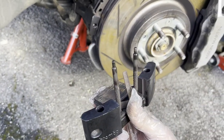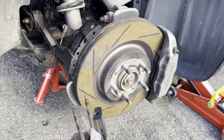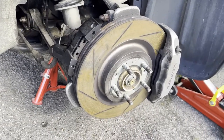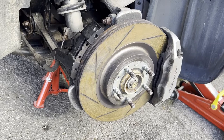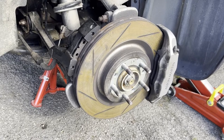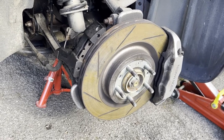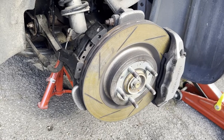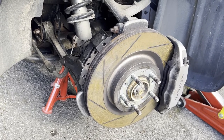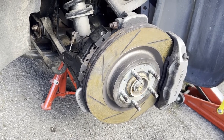Okay, so that seems to be a much quicker way. Now if you're replacing the discs, like I'm planning to, you can just pop the disc off without actually having to remove the whole brake caliper. I'm going to fast forward a bit to popping the discs off — there are plenty of other videos that cover taking off the main caliper and disc. The piston on the handbrake caliper is a windback style, and if you haven't got a windback tool it shouldn't be a problem — you can just do it with a pair of needle nose pliers, which I know has already worked.